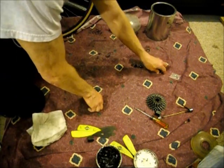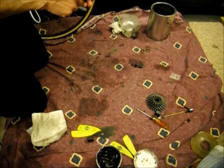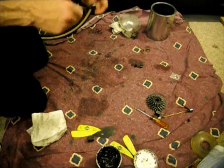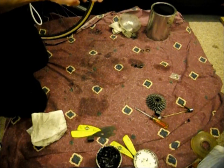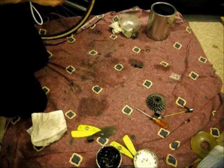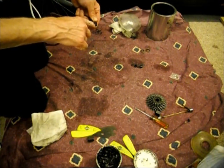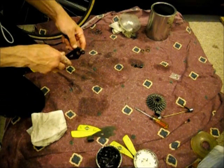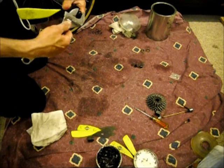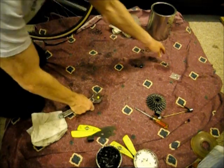That's all the parts there. Now I'm going to put the cone and spacers on one side — the side that the freewheel is not on, because that's the easiest to do. There's only one spacer. First I'll screw on the cone and screw it on a lot farther than I need to, then put the spacer on and the lock nut. Now we want to get to where we have about the right amount of axle outside the lock nut, then screw the cone back in towards the lock nut and tighten it into place. Set that off to the side.